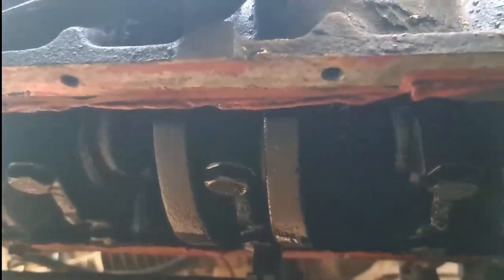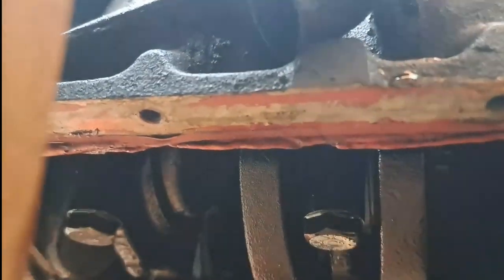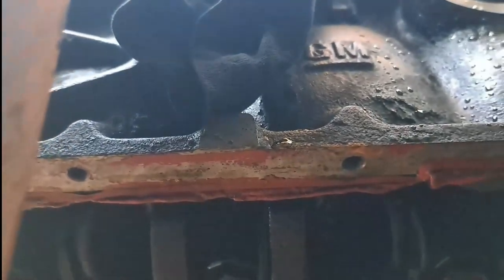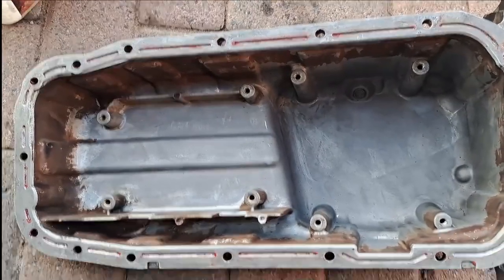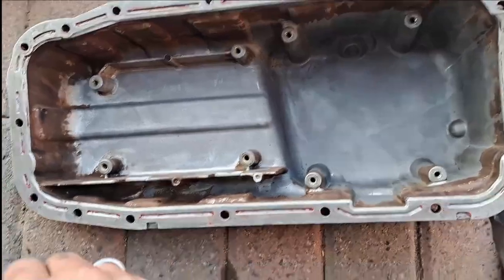As I was preparing to clean the side of the engine ready for the new gasket, I realized there was no gasket on the sump to begin with — no gasket on this side and no gasket on the sump side. Seems like they just put some liquid silicone gasket maker on and tied it down. Weird. I took out the sump plate and cleaned the entire sump.